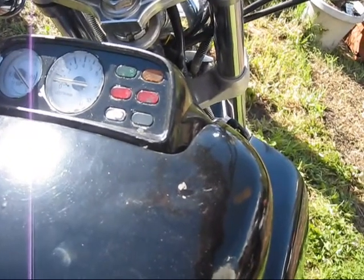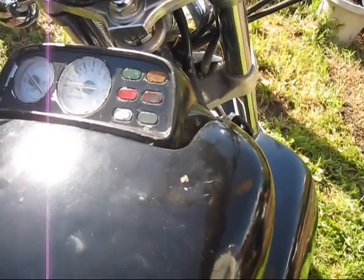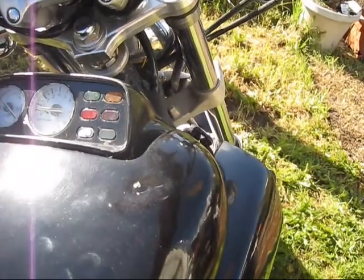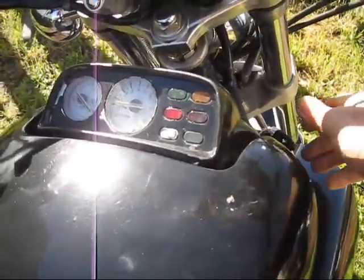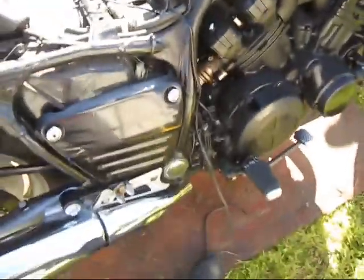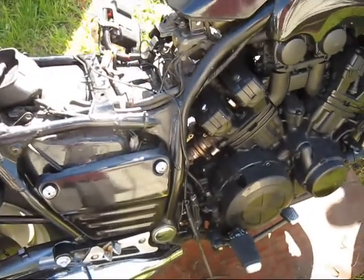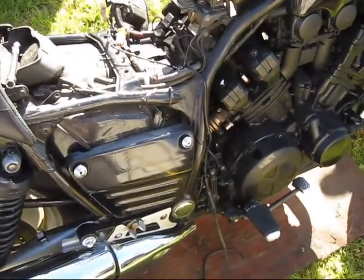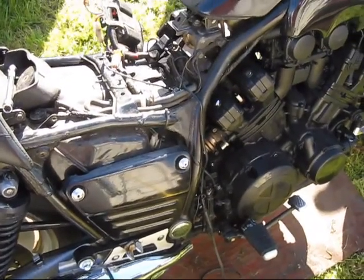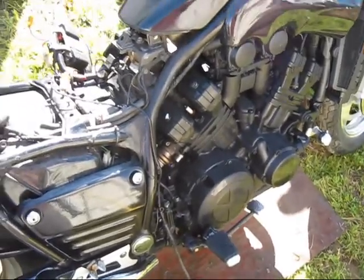All the computer is cycling, but it's still not doing anything. The battery is still dead. I've got another battery. I'm just going to jump it and see if the starter engages. I've got a feeling it's just bad wires — we'll find out.